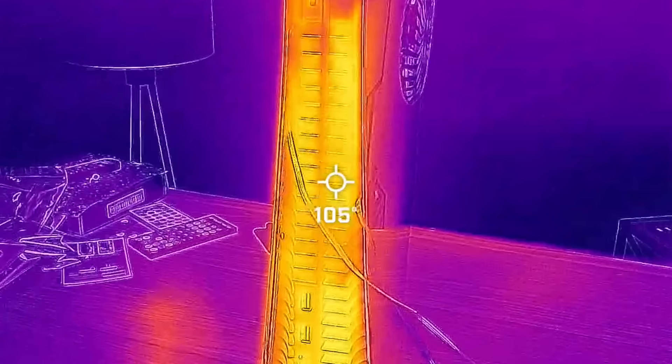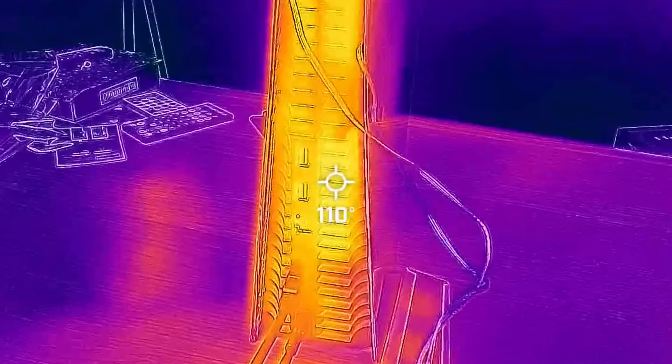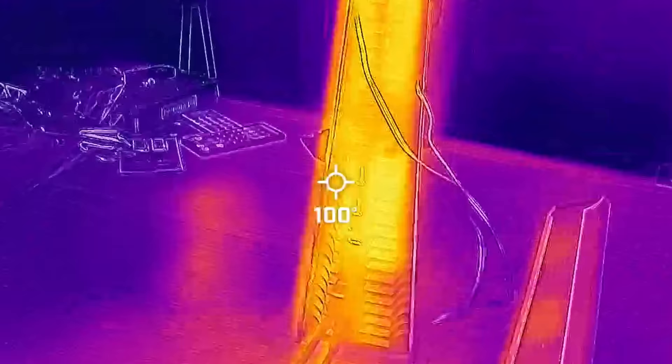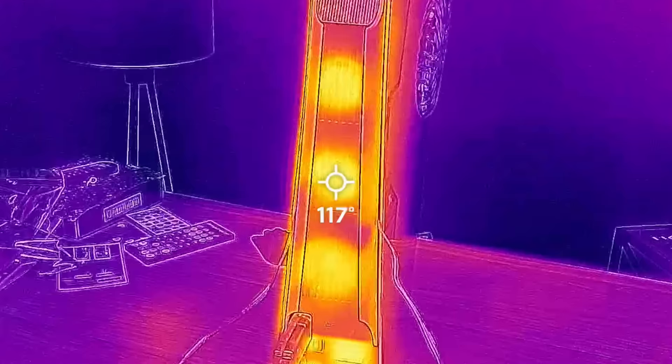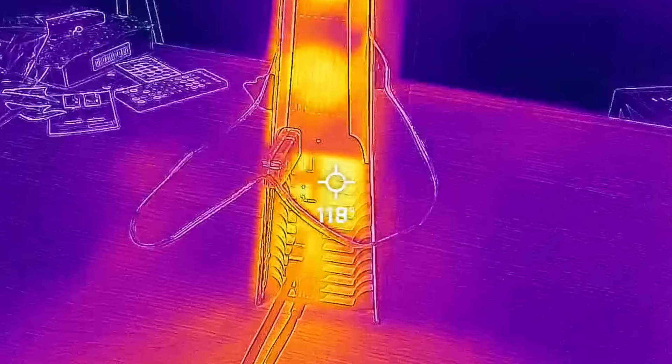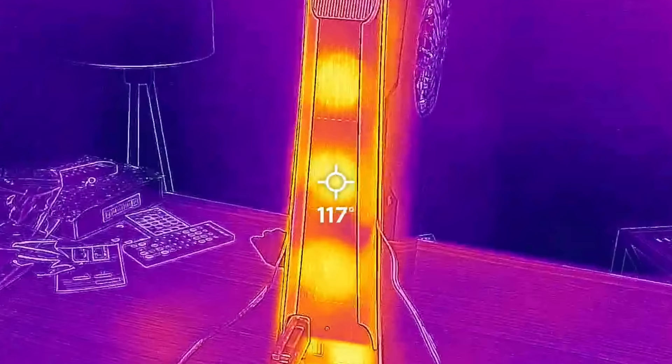I got Astro's Playroom playing on my PS5 right now and I'm hitting like 106–107 degrees on the back at the top and about 111–112 on the bottom with the thermal camera. I just noticed the fan is only mounted to the top so it doesn't actually do anything for the bottom, if it even does anything for the top. I have the fan mounted in full blast mode and from what I can tell it's putting out about the same temperature of air at the top as at the bottom. The main issue is it's blocking so much space around the exhaust — so it seems to be pushing air through those three little fans while blocking a bunch of area around it. Probably not great to put on your PS5.